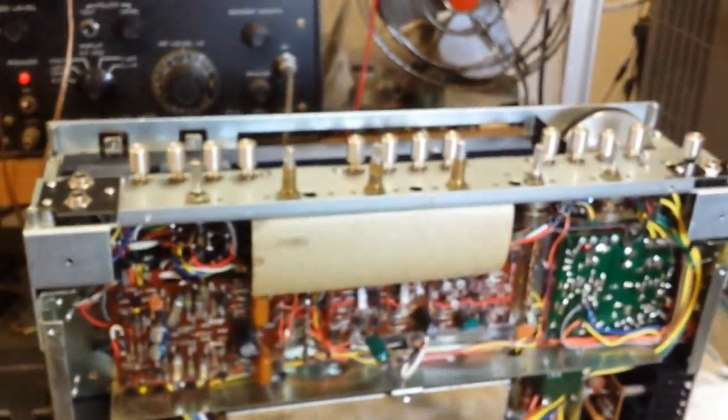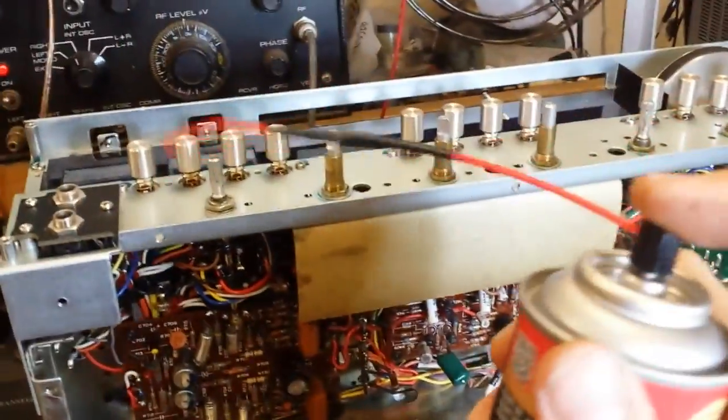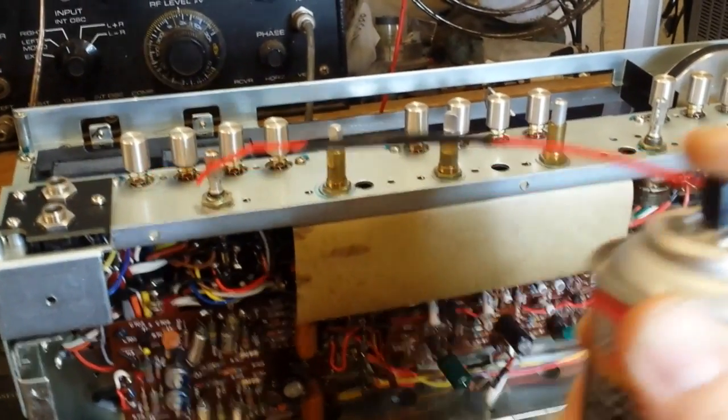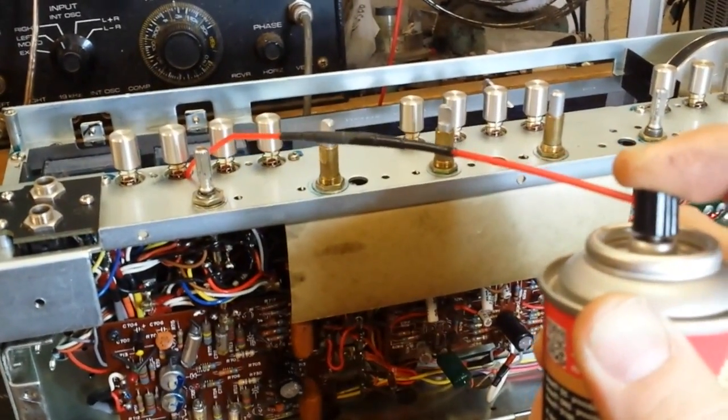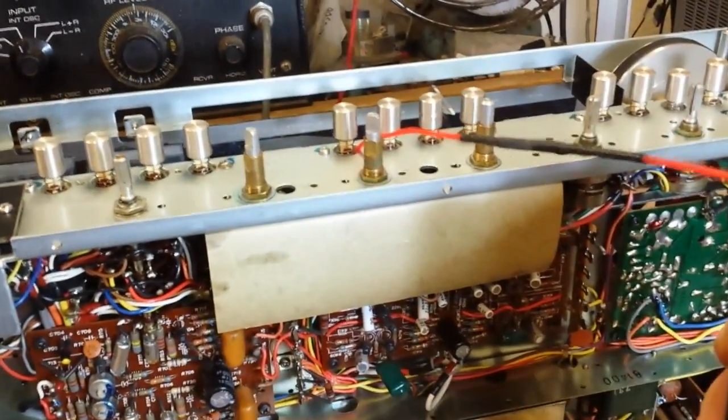To do the switches, what I usually recommend is to set it on its back, and if you're worried about it tipping over, stick a prop like a screwdriver underneath midpoint of the chassis to keep it upright. Then I'll put the sprayer on the lowest setting and just go in and squirt some Deox-It into the switch. Don't worry about getting the dial light stuff wet with Deox-It, because you're going to clean that anyway and have to remove it to replace the lamps.